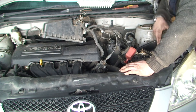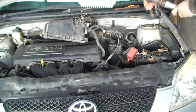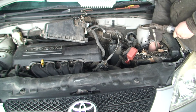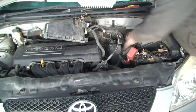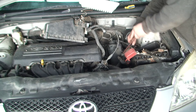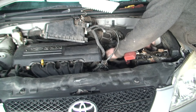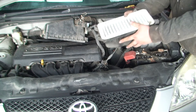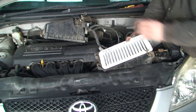Three 10mm bolts to take off the bottom of the air box. I'm going to use air tools because I've got a compressor and it's so much quicker. What I tend to do with things like this — you've got a few bolts and the clip from the air box — keep everything together in one place. I've got all the bolts in there so you know it belongs with the air box and you don't have loads of bolts mixed up everywhere.